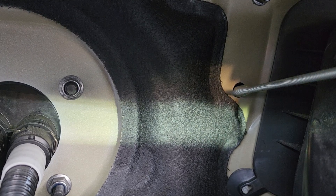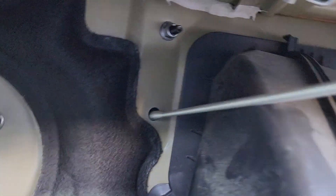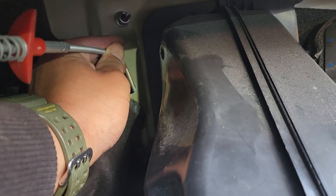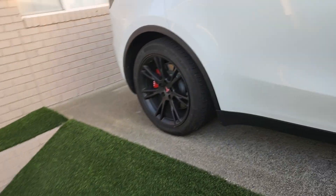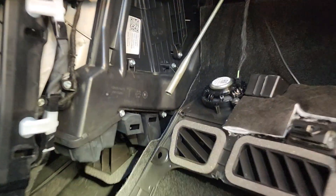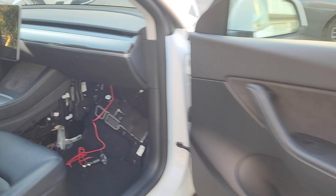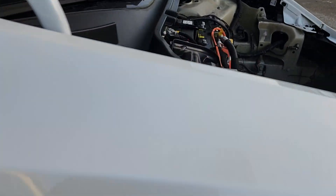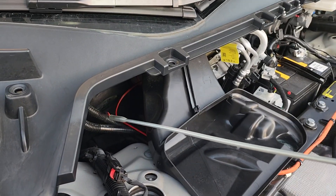What I'm going to do is stick the wire puller inside the hole. Once you get inside the hole, you want to direct it downward through the firewall. Once you direct it downward, it should feel free and then you'll see it pop out right there — it comes through the firewall and comes down. Once you get the wire puller through, you'll need a second person to feed the wire while you pull on it.